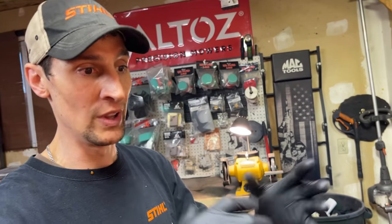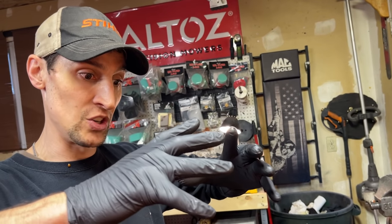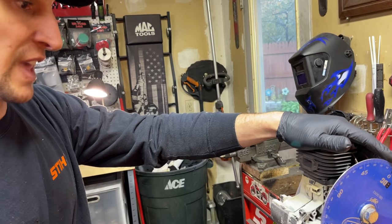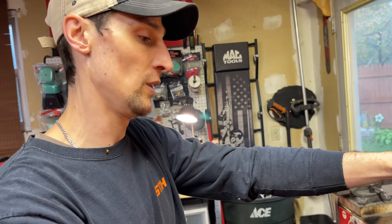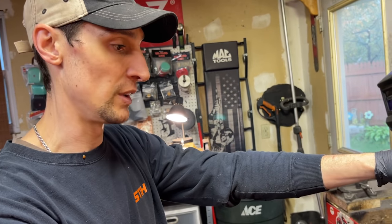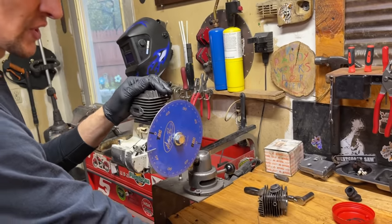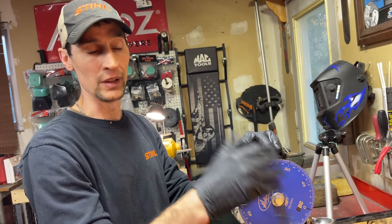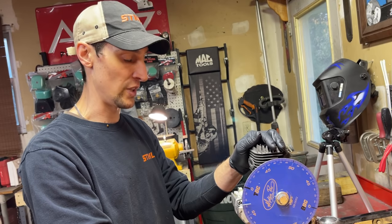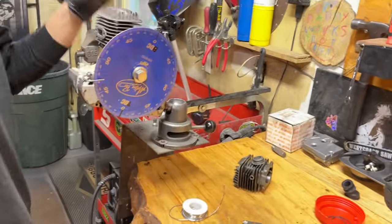You're shrinking the size of the combustion chamber. On your ignition stroke, that explosion powers the saw — shrinking the chamber means the same amount of material in a smaller space, more pressure. Like a water balloon: if you fill it and shrink it down, there's more pressure inside. This gains compression, and compression does relate to power — 100% it does. To do that we go to the lathe and machine the base. We had about 36 thousandths on the squish clearance, we're going to 19 — so we're taking about 17 thousandths off.